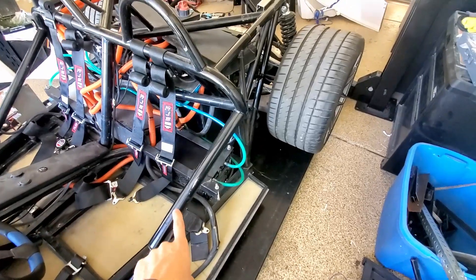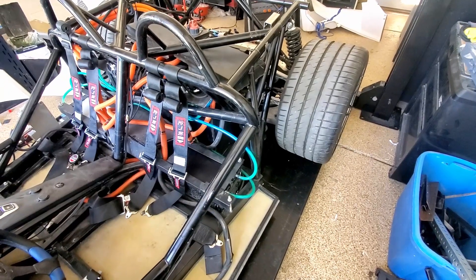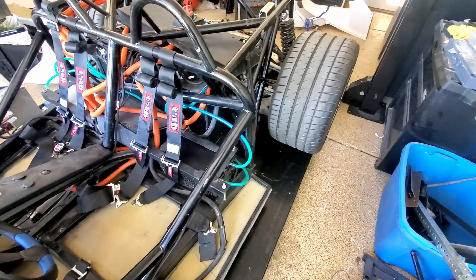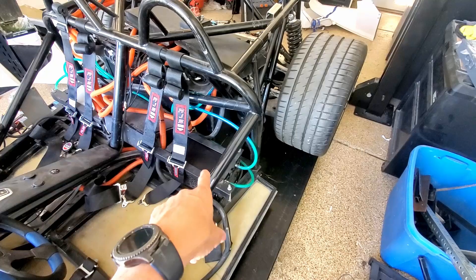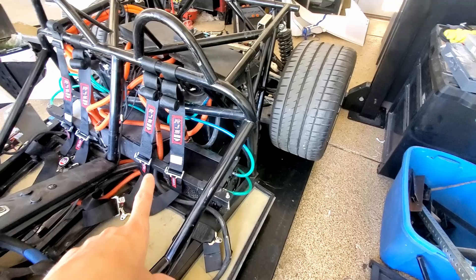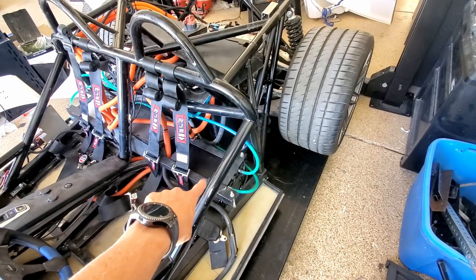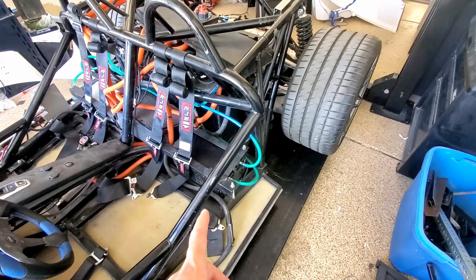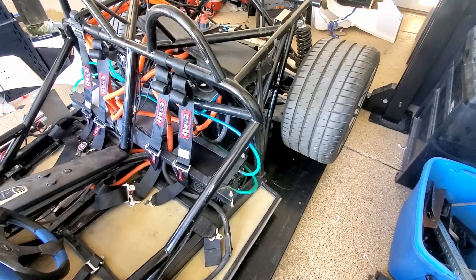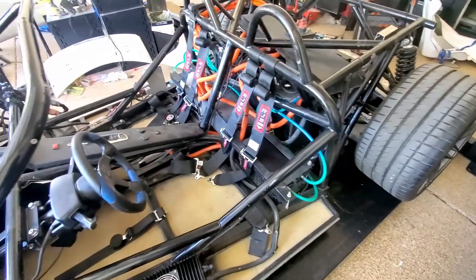One of the things we were looking at closely is the cooling plates - the cooling side of the batteries. It's not very isolated, and I do have these cooling plates directly contacting the battery module, so we could be getting some conduction there. I put some insulative material on, but I put it between the frame and the cooling plate. What I learned is that it can get conductive into your cooling plate, and the coolant is also conductive - so that can essentially be charging the frame as well.